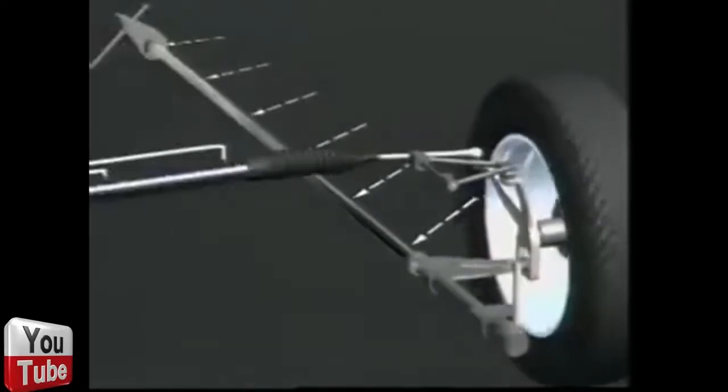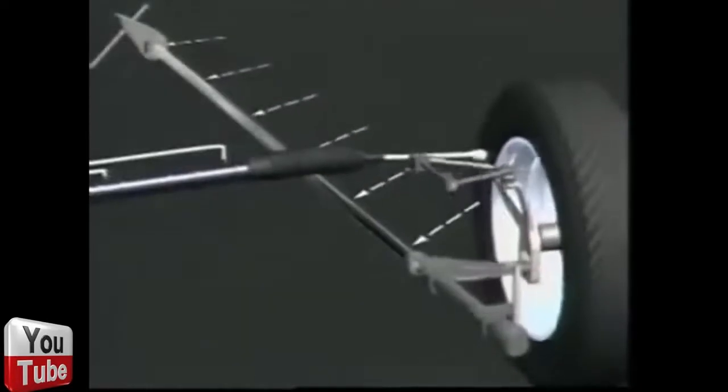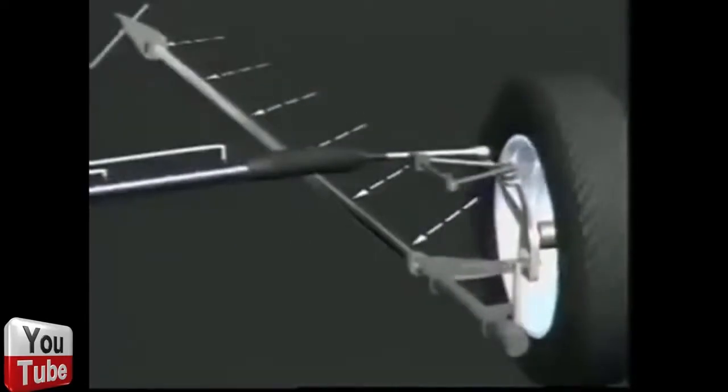When the vehicle is placed on the road with the control arm connected to the suspension assembly, the bar supports the vehicle load and twists around its centre to provide the springing action.